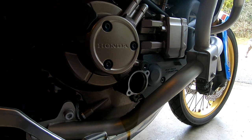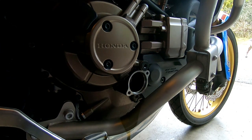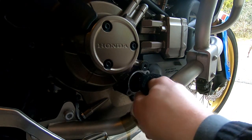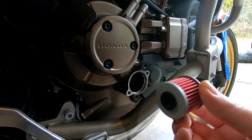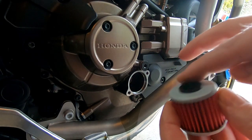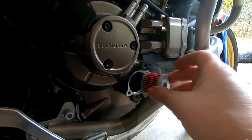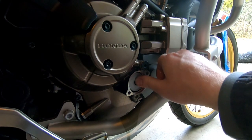Make sure you don't get anywhere near the sealing areas because if those get scratches in them, that can provide a leak path. Go ahead and clean out the reservoir for your DCT oil filter using a clean rag, and make sure there's no dirt on the outside that can fall in. We have our brand new filter — make sure the blank side is facing out and the rubber seal goes in first. Lubricate the O-ring just a little bit, then go ahead and pop it in there and make sure it is seated.